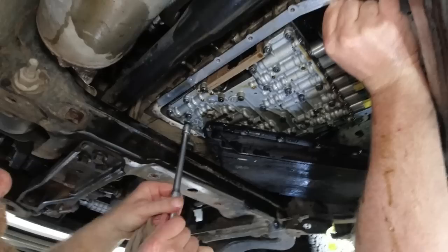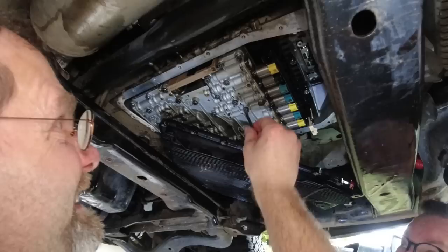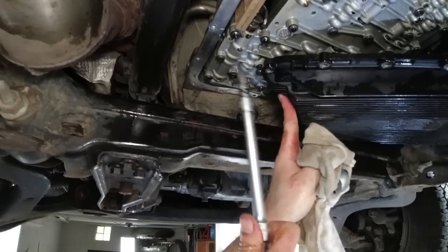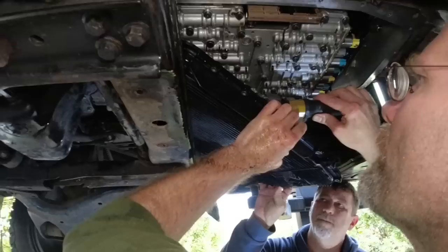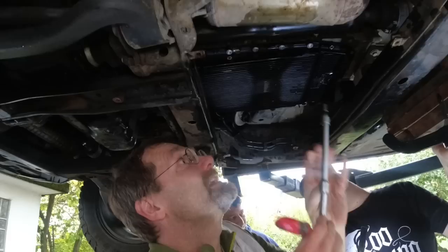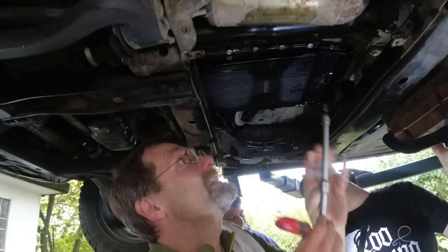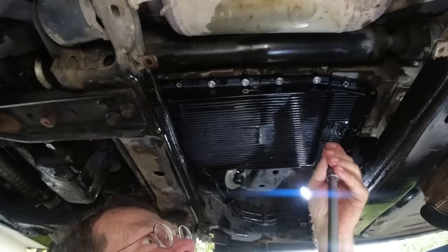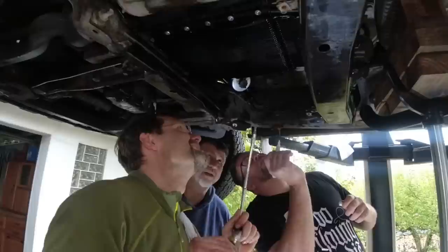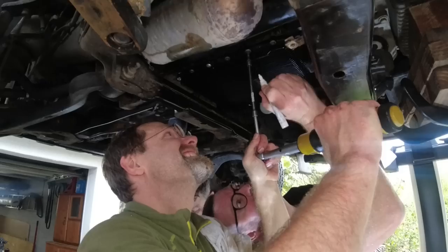So it's in. It was a greater debacle - I would say the biggest debacle ever. And the screws are so damn accurate, if they would be out of position by a tenth, they wouldn't go in. Oh boy. Just in case anybody's interested, we are talking the bolts for the Mechatronic unit - it's 9 Newton meters. The unit is in. I couldn't film everything because there was too much stress and too many people around, so there was hardly any room for me. If you guys want to do something like that, you better do your research and not use our video as a guide. We're talking 10 Newton meters. You better mark the screws or bolts which you already torqued. So you have a torque sequence when you buy your ZF unit.